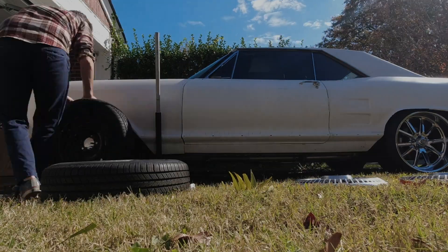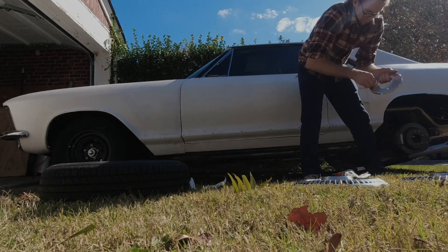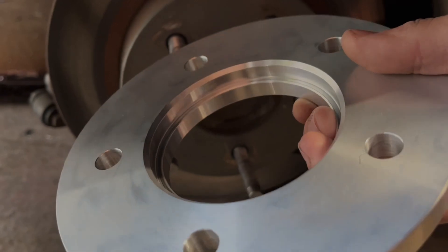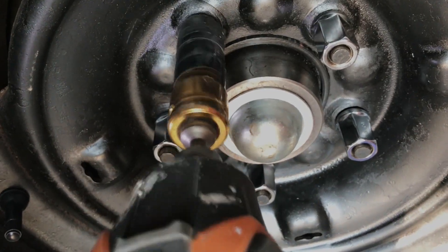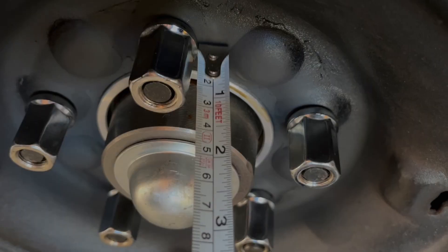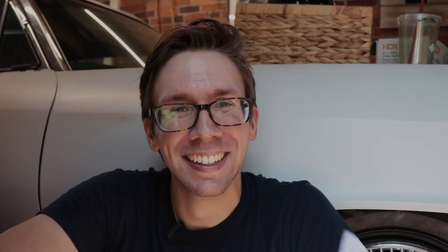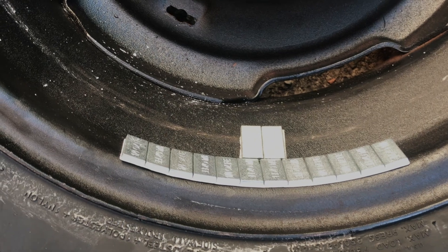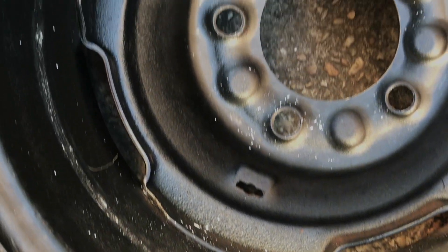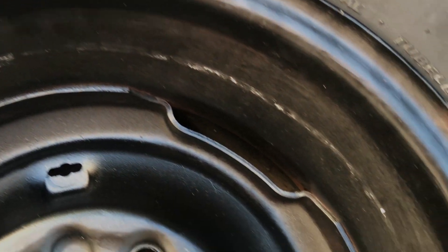Here we are breaking down barriers that don't even make sense. I've already installed extended studs and open-ended lug nuts, so I didn't have to worry about the studs being too long or too short. I like to see one and a half times the bolt's diameter as thread engagement as a minimum. We can also thank Discount Tire for installing a ton of stick-on wheel weights on the inside of my rim instead of the hammer-on kind, but still using hammer-on on some wheels and stick-on on others.